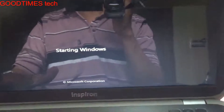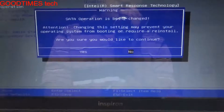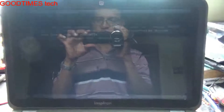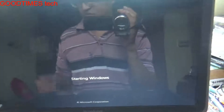Turn it on and go to BIOS. As we have installed Windows 7 in this laptop, we need to change the SATA operation settings. Select it to AHCI. Press F10 for saving the BIOS settings — press S, select S and press Enter. Now select 'Start Windows Normally.' It will boot up normally, overcoming the blue screen.